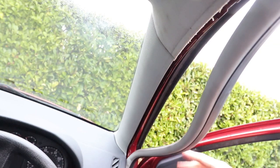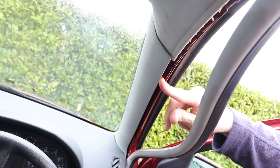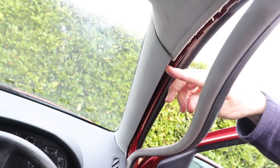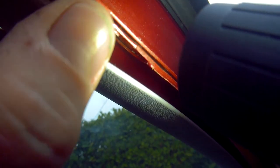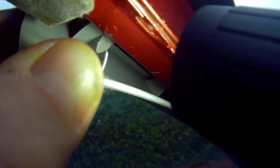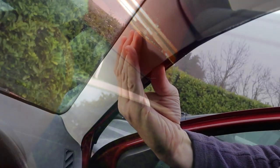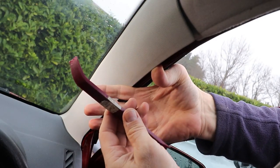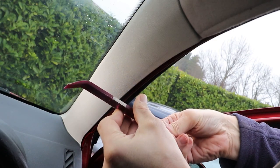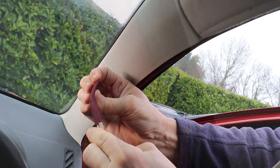The clips are quite tight and often come away from the panel or even break in the holders, so you really need to do this carefully. You need to release the top clip first, and if you prise it back a little bit and shine a torch, you can see where the clip is. What you need is an angled flat-bladed tool, such as an angled trim screwdriver or a nail puller. An angled trim tool is just about strong enough, but it's still much better than just a straight screwdriver, as they tend to pop the panel off before you get onto the clip's holder.